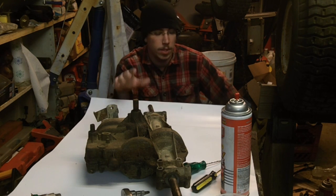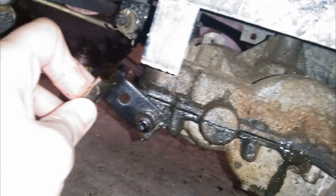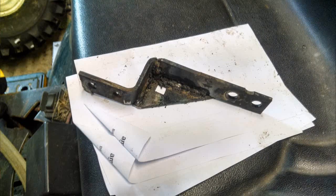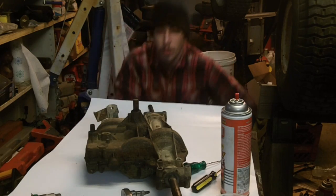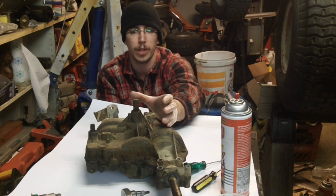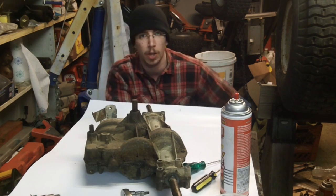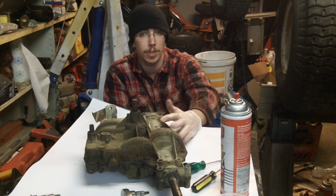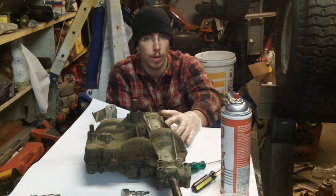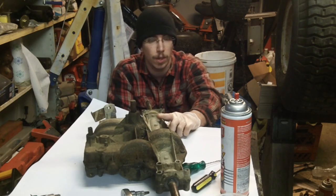One thing I'd like to point out is the transmission never actually fully failed. What I discovered was that in the setup where it mounts to the bottom side of the main mud mower, it actually snapped off the front transmission bracket, causing the belt to slip on the smaller pulley as the machine torqued up when you'd let the clutch off. I actually removed it and put in the MST 203 that I converted to an MST 206 — you can see the video for that in the description, along with the original video for this setup.